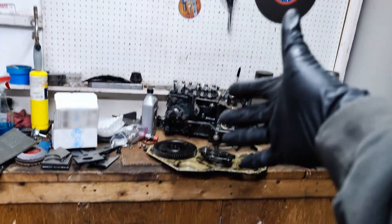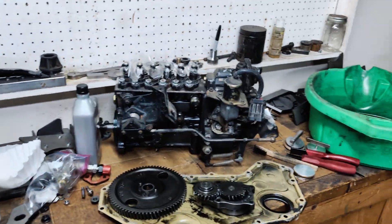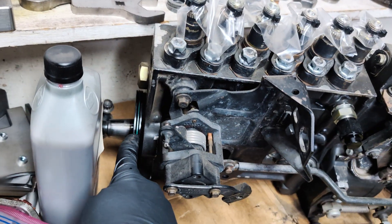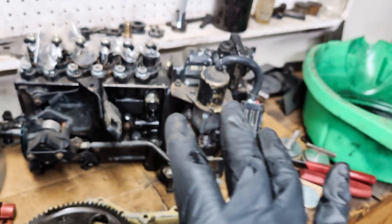As far as the P-pump goes, I'm not changing anything there. It's already had 4K's in it and it's got towing delivery valves. I don't want to change anything. The only thing I'm replacing on it is this seal that goes into the gear housing. It's been working fine — not going to touch anything else.